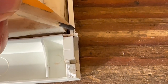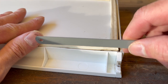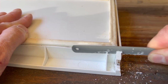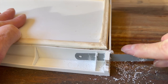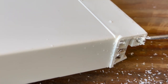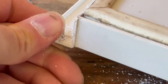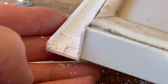First, place a little pencil mark here as a registration mark so that you know where to place the new hinge plate. Next, carefully remove the old plastic. The best way to do this is very gently using your hacksaw blade or coping saw — you really don't need any power tools. We're just trying to remove the broken segment while leaving the visible outside plastic in place. Once you've made the two vertical cuts, you'll find that this old molded-in plastic is probably just going to break off — it really does become that brittle — and it leaves you with a channel that you can place the new hinge plate in.